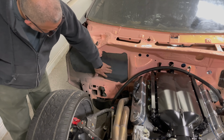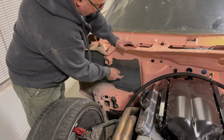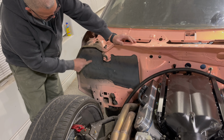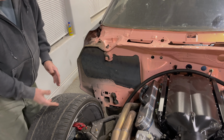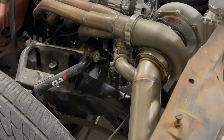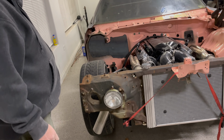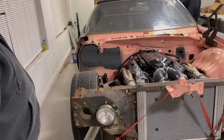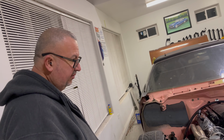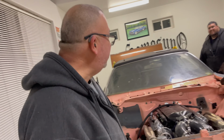I wanted to bring it here. I got you. So it's going to be a manifold. Mm-hmm. Here you got the hoses, but I think that's going to be in our way. So what am I going to do coming out of here? Hoses, so the fenders, and then from here, come into the water pump to get your heater. And then from here, it'll come to the condenser and the dryer for the AC unit here. And that's for the vintage air. For the vintage air. So are you putting the vintage air in yourself too? Yeah, we put him in the chair here. Okay. So when he leave here, he should be chilling. Yeah, he'll be chilling to the paint shop.